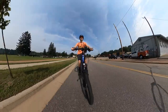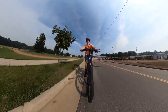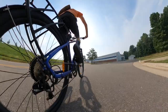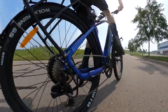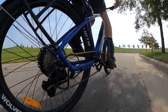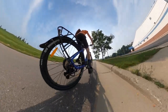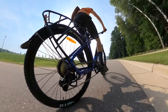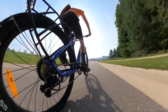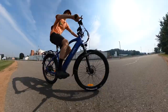When you look at the components, it's pretty clear these are not name-brand components — except those WTB tires that came on mine, which were a nice surprise. You won't find entry-level Shimano or Tektro components found on so many bikes around this price range, and that's probably how they offer such an attractive price. But even without name-brand components, this bike still performed well. I actually preferred these S-Ride trigger shifters over Shimano thumb shifters, and once I got the derailleur dialed in, it has functioned perfectly. The hydraulic brakes don't compete with premium brands on feel, but they felt better than mechanical disc brakes and were good to go out of the box.